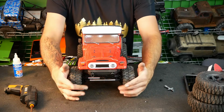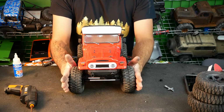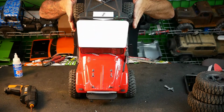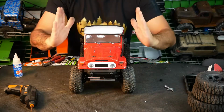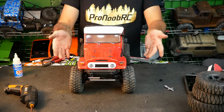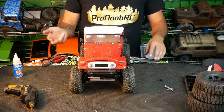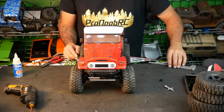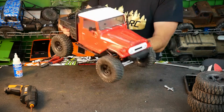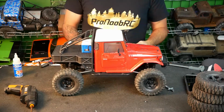We do need to change the front steering link because it has a 3-degree toe out. The rear has these lockouts that have a 3-degree toe in, and both axles are cambered this way 3 degrees. It is set up as a racing truck. Right? I would say so. It's a race truck. We'll go with that.